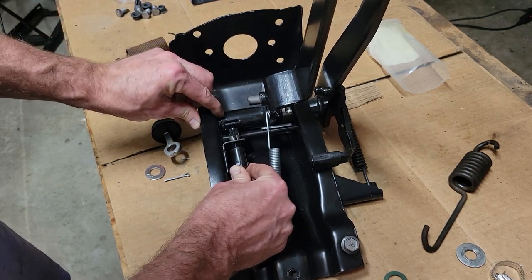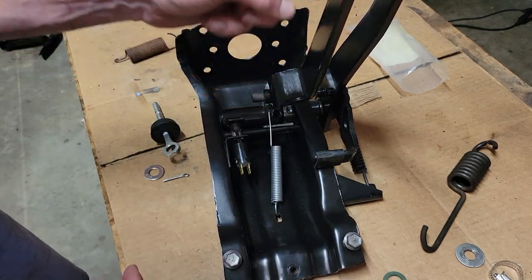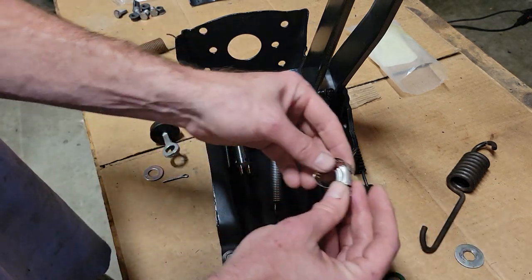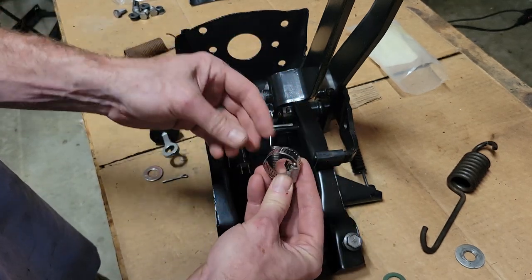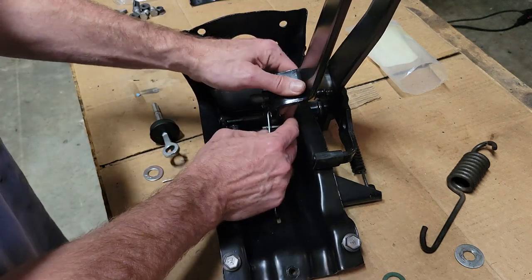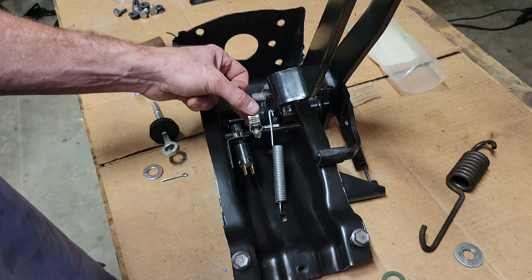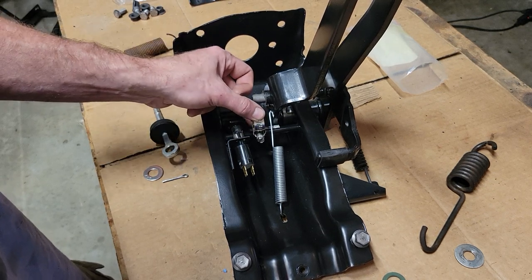And I can push the brake light switch a little forward so it's engaged. And then the brake pedal here is down another inch or so, which made it much more comfortable to hit the brake. Now, I was able to take one of these clamps here, and I had to undo it totally. A smaller one would probably work a little bit better, and go over here. Now you can also, depending on how you can get to this, have this slit over here, and you just clamp it on there. I had it on there for months and it worked perfectly. It was super stable. It was safe and it was there. So that's one way to do it.